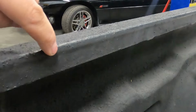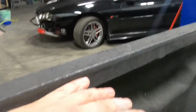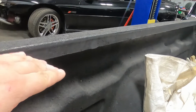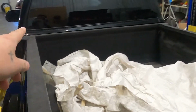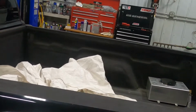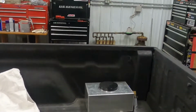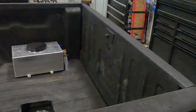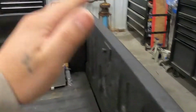But if you guys look at these beds, it's got a little lip right there, and that's exactly 1/8 of an inch. So if I got 1/8 inch aluminum, which is thicker than what people generally use, and I just put it right on that, it would be flush with the bed, absolutely flush. And I can use aluminum angle iron as structure if I need to, but we can have it come all the way from the front. And if I use two sheets, I use the 4-foot side of the sheet, it lands, I think, right here, and if I put a full length hinge across here, we can just use hood pins somehow on the angle iron. We can undo the hood pins, flop this side up to get to the ice box, flop it back down.